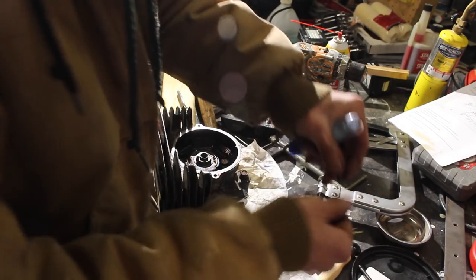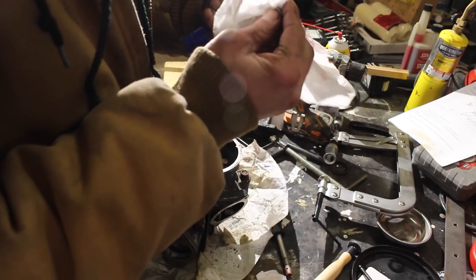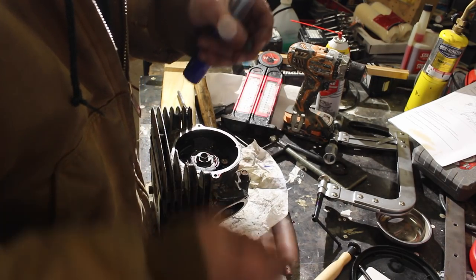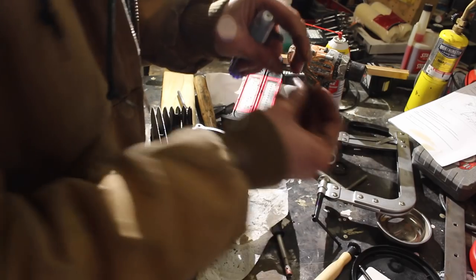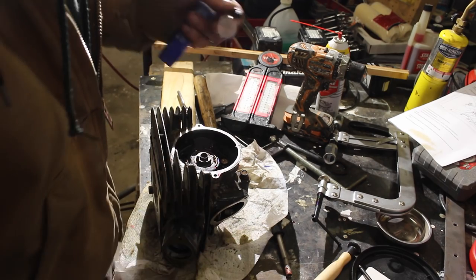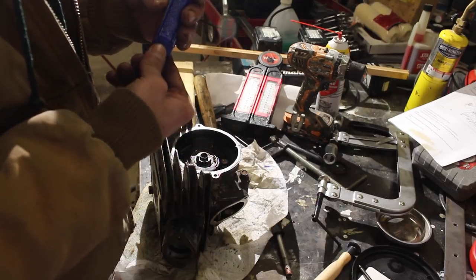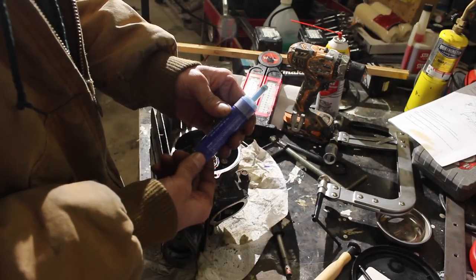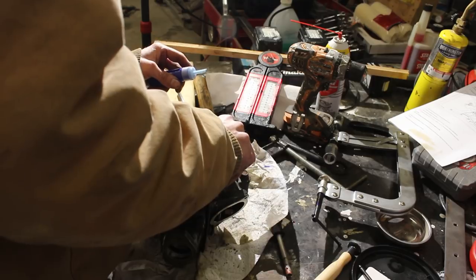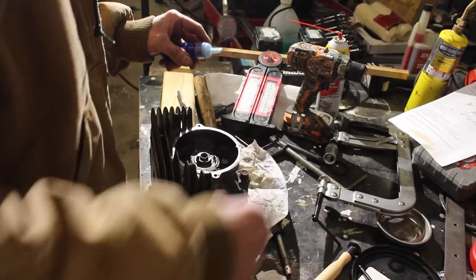And technically when you get into bolt holding strength, there's actually calculations for oil on threads, and certain applications require that for high speed machinery and other things. So basically if you're using Loctite, which I am going to because it holds the main camshaft on. This stuff's awesome, by the way. It's a twist gel. I like it way better than the liquid. Just need a little bit on there too. And I should have bought the manual, but I don't have the torque spec, but you get a feel for it.